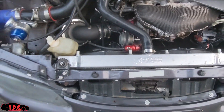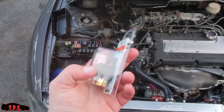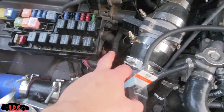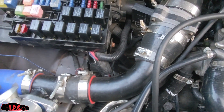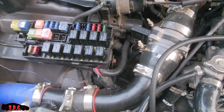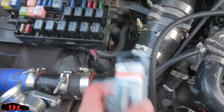Basically what I'm going to try to do today is wire a relay - an RL44 40 amp relay, because they didn't have any 30s. I can replace this later, but this is a mountable relay. I'm going to stick it off to the side here, maybe off that bolt right there replacing a 10 mil, set off the fuse box. We're going to build a little loom to use a relay to trigger this fan system. We're still going to let the ECU control it - when it hits 210 it should trigger the fans on. We're going to give it more constant power from a source that's not going to keep popping.